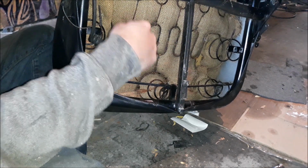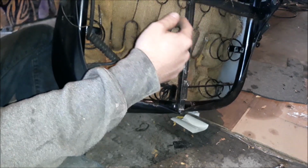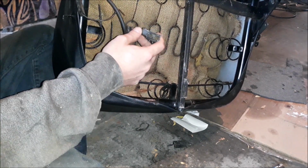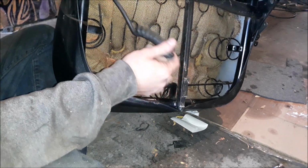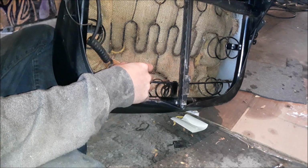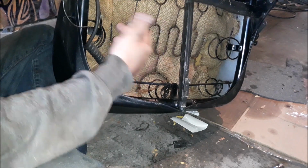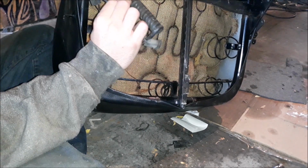And basically if it notices pressure, if someone's sitting on it, it sends a signal to the warning switch for the seatbelts and flashes a light on the center console. This one, obviously, is the pigtail that's supposed to go to two connectors that go to the seatbelt female ends, but it doesn't have the sensors, so I guess whoever had this before me just decided it was good to keep anyways.